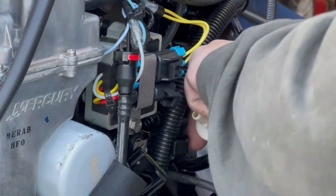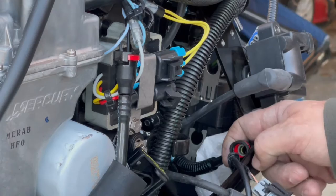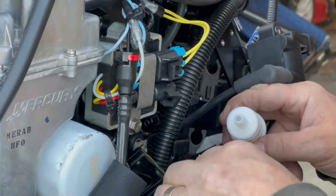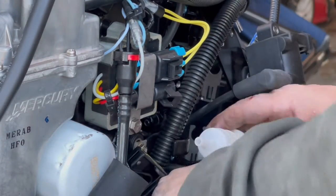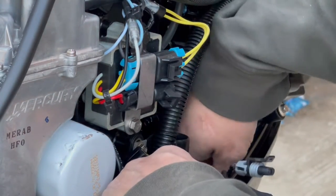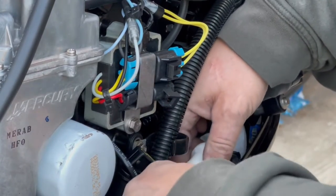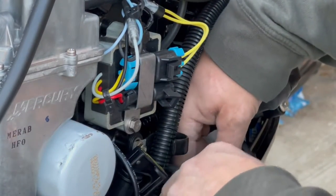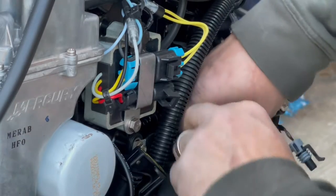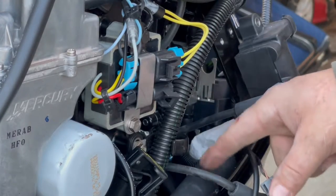I took the other piece off — all we're going to do is unclip it. Remember, arrow facing back of the outboard. All it does is clip on, no big deal. We've got to grab the other end right here, take it underneath everything. There's fuel. Boom — so that's done. You want to be quick about this. Get that sleeve back over this whole thing. We're going to zip tie this. Cut your tag ends off.